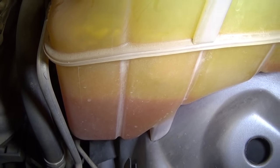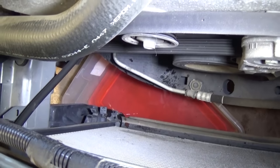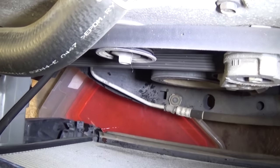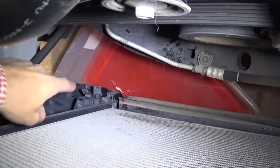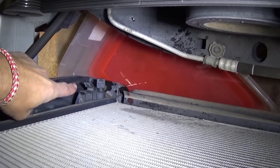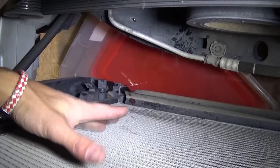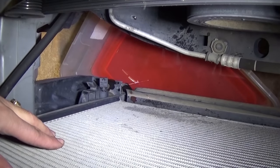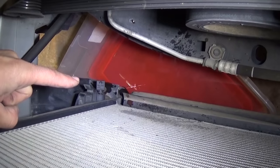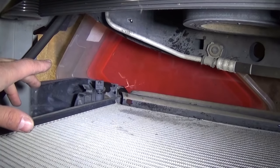It's going to take about 10 to 15 minutes to drain the whole system, so give it some time until it's empty. After that, you need to get the valve tight — you can reach it from the bottom no problem. You don't have to remove the fan for that. We also have a video on how to bleed the system, because if you don't bleed it you're going to overheat the car — check out the channel.